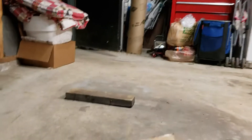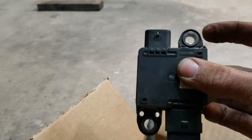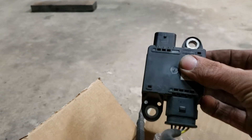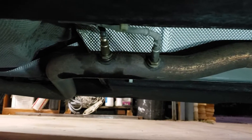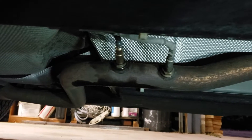What you're going to do is take this composite panel off, and up here where your fuel filter is, you'll see that same square module. It's hooked into the sidewall with two — I think they were 10 millimeter bolts. This top one's a little tricky to get to because the fuel filter housing is in the way, so do your best with a small ratchet to get that loose. Take those two off, unplug the old one, and you'll see that the wire holding the NOX sensor and the O2 sensor are bound together and tied with zip ties in several places.